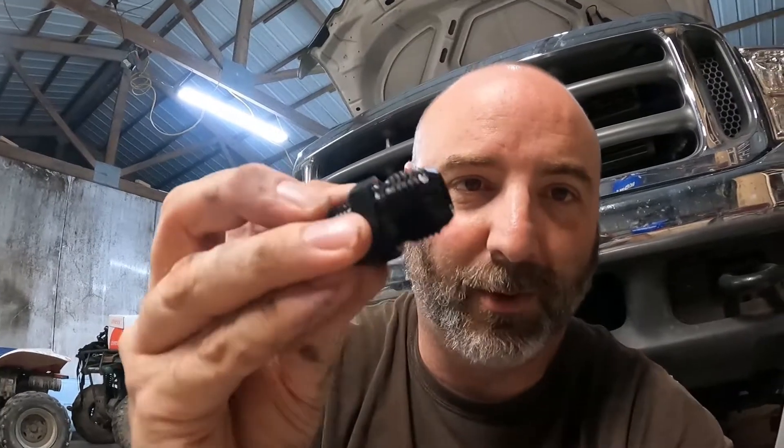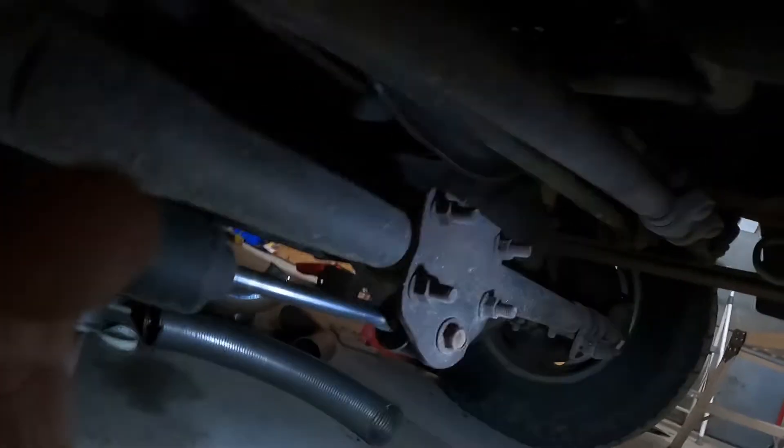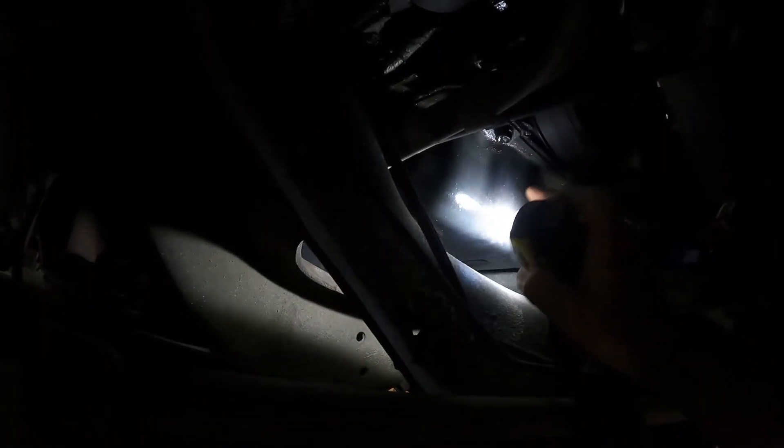Until I can get a new drain line, I'll go ahead and try to tap the oil pan. When I used to do this on old pushrod V8s — the 302s, 351s — I'd always go through the side of the oil pan. I couldn't get a good shot of it here, but if you look under your truck, the K-member is just not accessible. This is the piece I always used on the old small blocks — it's a 3/8 NPT to a dash 10 AN. So I started looking at what the 4.6 liter Mustang guys do. It looks like they go straight through the front of the oil pan, which is a lot more accessible on this truck. The 5.4 and the 4.6 are very similar engines, so I think that'll work just fine here.